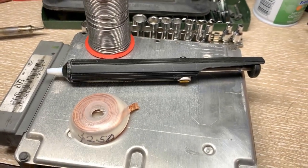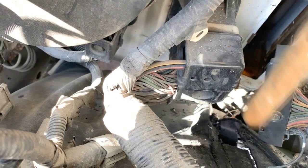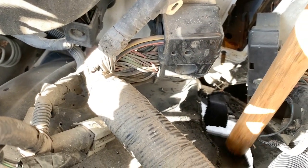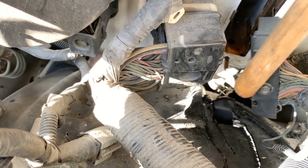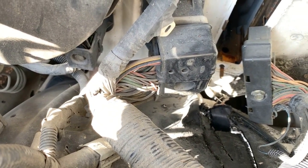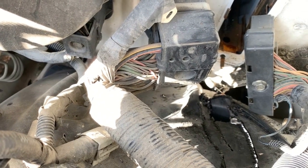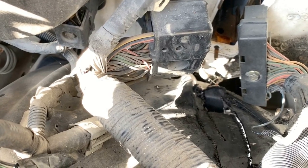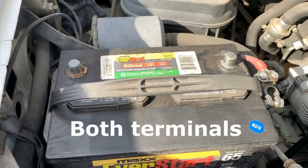There's not much solder on the connection so it should come pretty easily. One bit of bad news: getting the computer out of the slot on this '96 truck, I had to cut through the internal cowling plastic material using a rotary tool. I'll repair that after reinstall using RTV to fill in those cracks so water can't come in. I tried to disassemble the internal cowling but was unable to — it goes in after the engine and before the wheels, so you can't undo enough. Make sure the battery is disconnected before you do anything. That's your first step.